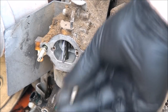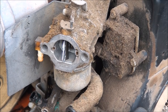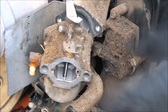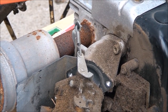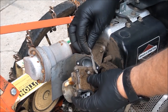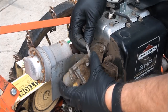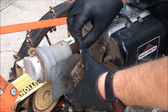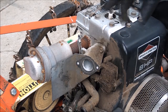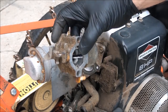This carburetor is only connected with these bolts. To get it off the linkage, what you need to do is basically just rotate it back up here. To get it off the linkage you just want to rotate the carburetor. I almost have it out. Disconnect the linkage and the spring. I have to bend the spring back into shape. So this is what the carburetor looks like off the vehicle — let's open it up.